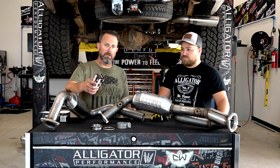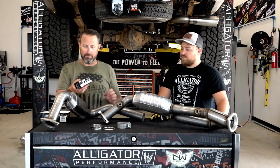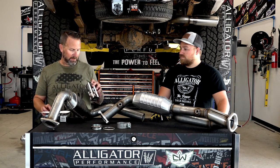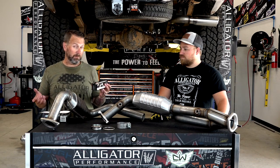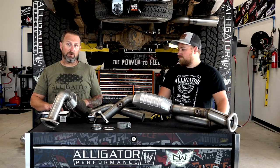There are two front O2 sensors and two rear O2 sensors with two different part numbers. If you're using Bosch parts, one is part number 15152 and the other is 15284. We're going to unplug the old O2 sensors from the truck, install the new ones, plug them back in, and thread them into the new catalytic converter kit.